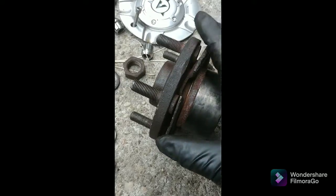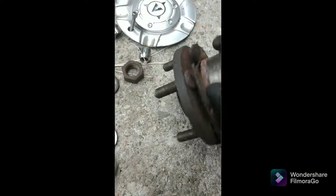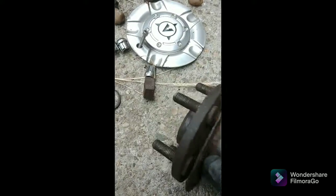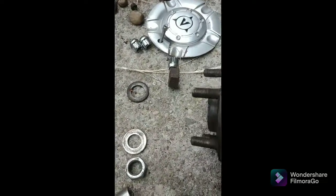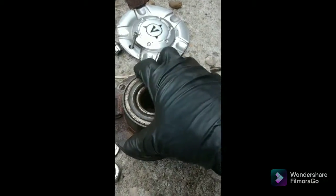It only came with a separate bearing and a separate hub. So I got to reuse this steel part. I still can't get it out because I got to get this part out. And it's just so tight. I'm hoping the other side is not nearly as bad. But once I get this centerpiece out, which I might be able to do on the press, it may get bent up and then I have to flatten it, straighten it out just by hammering it flat.